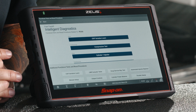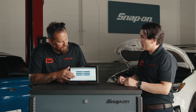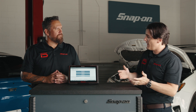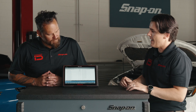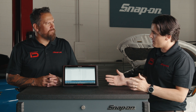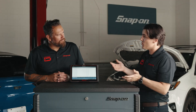What are we looking at here? We're seeing variant learn, compression test, cylinder 1 injector, and a bunch of different options. These are functional tests and resets for that code, either in the diagnosis phase or the repair phase. We're still diagnosing, so we'll jump into cylinder 2 injector. We'll hit continue. Now the functional test is displayed — this is our live data. We're going to disable the injector while viewing live data and actually while checking the vehicle.